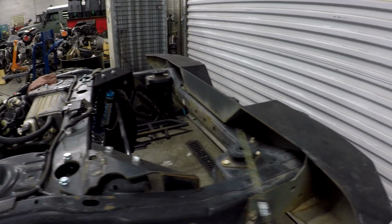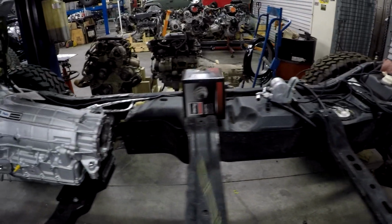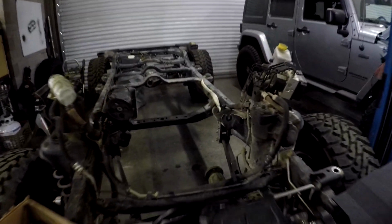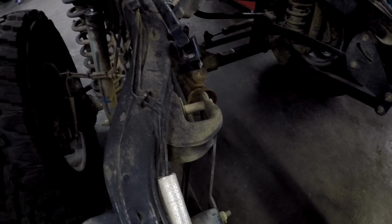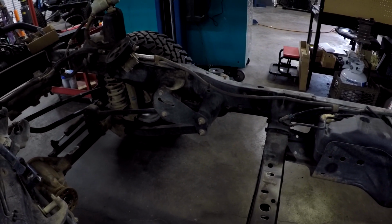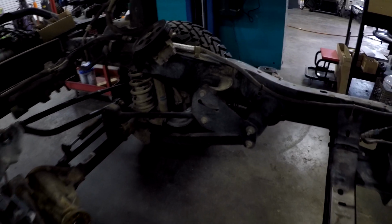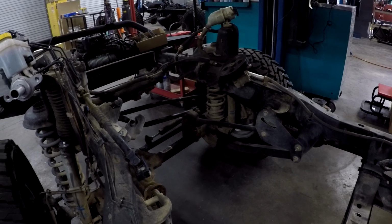to side. So we got our rear frame, cross member 1, cross member 2, cross member 3, cross member 4, and then our cross member under the engine. And if you want a quick look at that with the engine out, so here's the stock pickup points on the stock chassis. You'll notice that they're inboard here. Unfortunately, this guy is running drop brackets, as you can see. Not a big fan of that because all we're really doing is lowering the suspension pickup points. If you look at this, all we're doing is dropping these down, and that's raising the vehicle, but it's not really doing a whole lot for articulation, travel, etc. It's just raising the roll center, in my opinion.